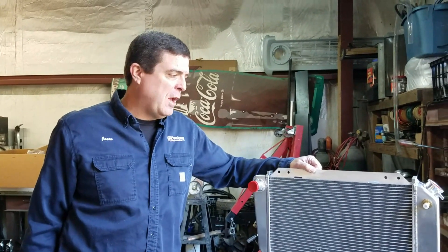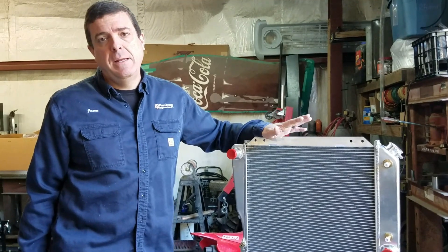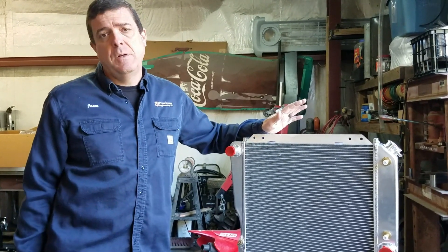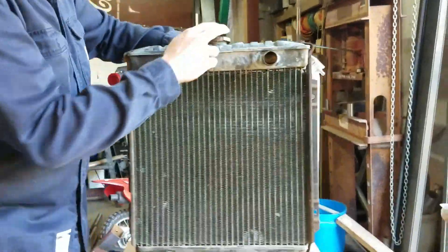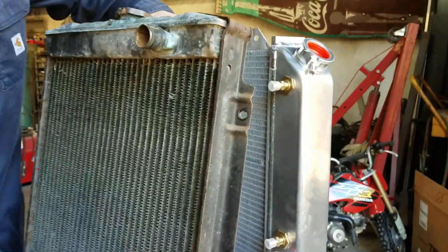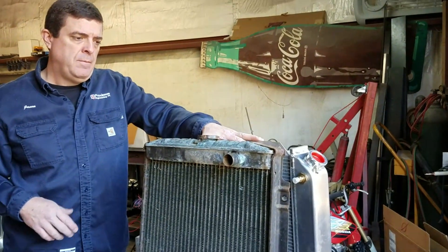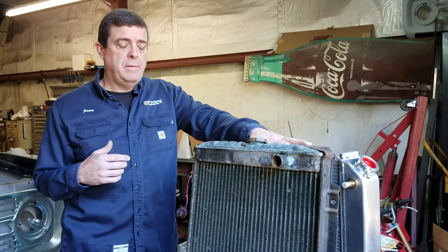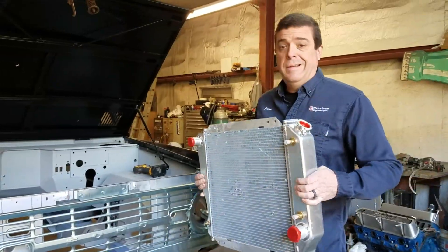Joni stopped me to ask a good question: why am I doing all this? Why didn't the brackets come attached? My Bronco is a '66 original six-cylinder. The grill opening was smaller in the original, and the original radiator mounted to the side of the radiator opening. These newer style radiators don't mount the same way, so I didn't have a reference point. Some of you guys may be making this same modification and you'll understand why I'm having to work through this.